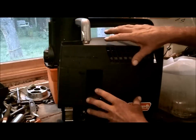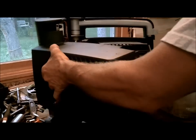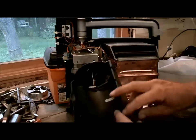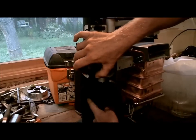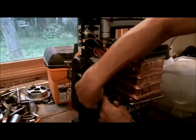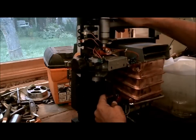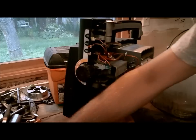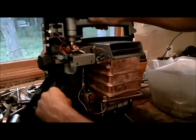Once you've got that unplugged, this will not come out at that time. But to show you what you have to do, I'm going to pull this off. Before you can pull that off, this is up inside of here like so — that's right where your gas unit goes in right here. You can see this hole right here. There are these little screws like this; there'll be four of them — one, two, three, four. You'll pull them out of both sides. You're going to need a small screwdriver like this. After that, you're going to be pulling on it and you still won't be able to get it out. There's one little screw right here that attaches this side to that side — it's a little tiny one that looks like this and it has a little nut on the inside. Pull that out and everything will come apart real easy, just like so.